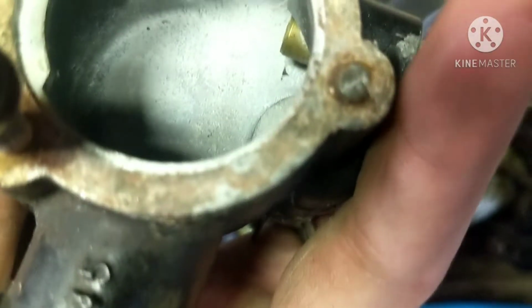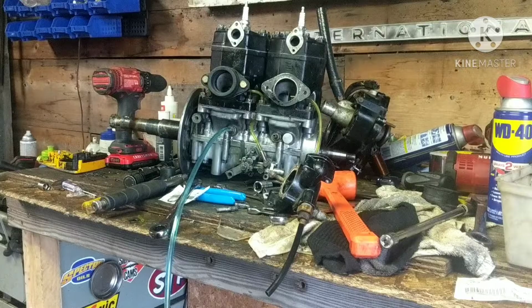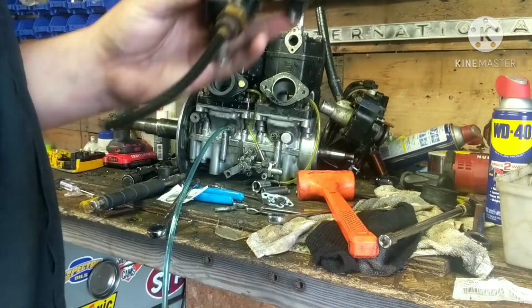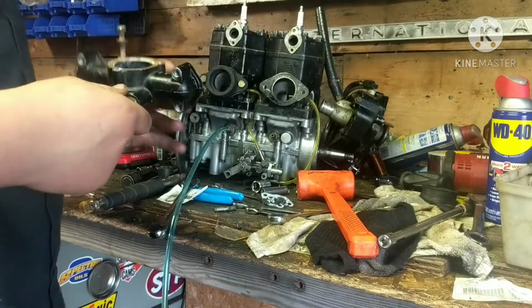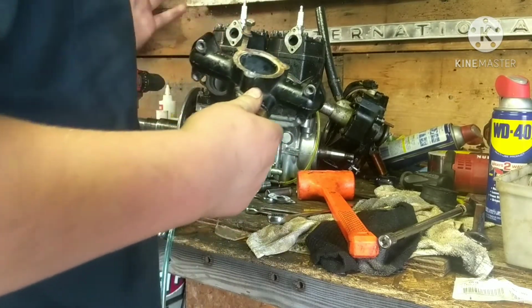But anyway, you can see here there is a broken bolt there. It's supposed to have bolts like this in it. This bolt broke out. And I'm going to use the old weld a nut trick and back it out, hopefully. Alright guys, so I got the thing drilled out. I was going to do the weld trick, but I tried it, just would not work on this one. This thing was really stuck in there, but it drilled out much easier than the attempts I tried.